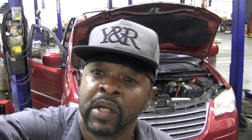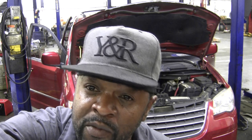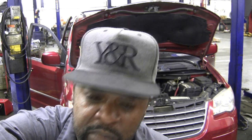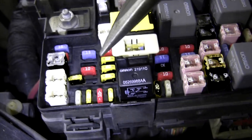These power outlets and cigarette lighter are protected by 20-amp fuses. I'm going to show you exactly where they're located — inside a module. Some people still may call it a fuse box, but it's not a fuse box; it just happens to house fuses. This is a TIPM — Totally Integrated Power Module. This is where most of your relays, most of your fuses, and most of your drivers are located. The fuse that feeds your power outlet in the rear happens to be an M7 fuse — that's the 20-amp fuse inside your TIPM. All you do is pull the fuse out and see if it's blown. If it's blown, there's a reason why — they don't just blow for nothing.